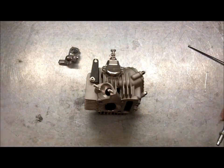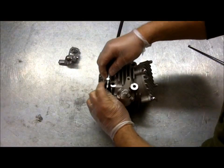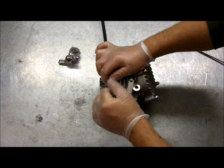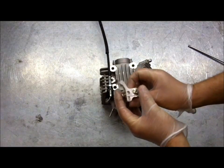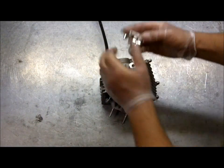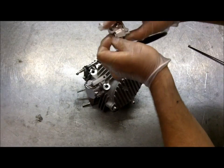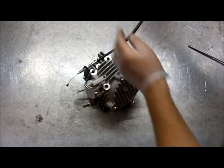Our next move is we're just going to fit the cable in. It's a bit early but we'll get it on first — it's a little easier to do it with the head off. Just get the cable loosely on; it's got a massive amount of adjustment which we can use later if need be. Next move is to connect the cable into the actual finger lever. We do that first because when it's closed it's blind — you can't get it in afterwards. So start with the end, we're just going to latch that in, put it into the gate, and then lay that out of the way.